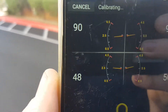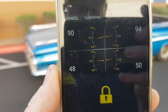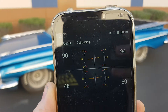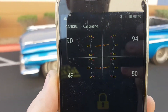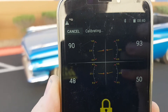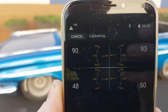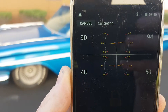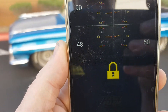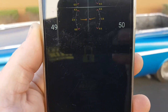This is how we calculate corner load. Corner load is the single most important part of any airbag suspension system. If you don't have a way of measuring corner load — which is height and pressure — you can't determine when the car is on uneven ground and the car will become cross-jacked. Cross-jacking is essentially when the load on one corner is not even on the opposite corner — like a bump or a dip in the road, or sitting in traffic. Our system has a brake monitor, which allows us to pause any adjustments while driving and prevents unwanted adjustments especially when sitting in traffic.